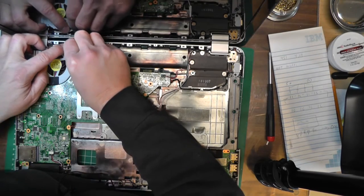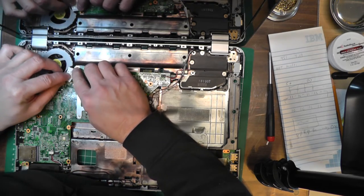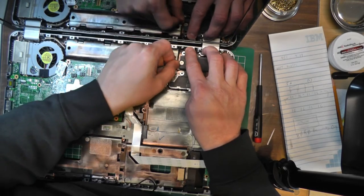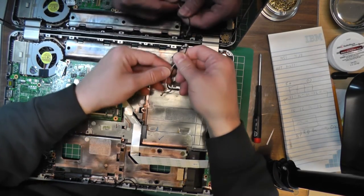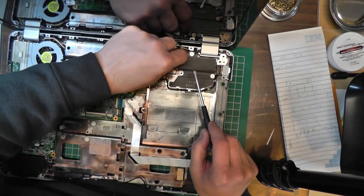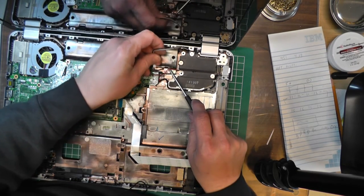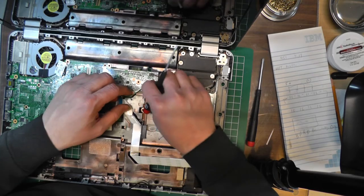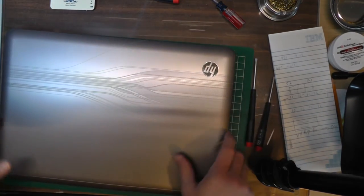You have to be careful with it when using it. The VGA cable plugs in here. I can see where it looks like it should go, but these should go underneath — this red wire I already put in here — and I need to get them in here. Actually, they need to go down through a hole underneath the motherboard into the bottom of the computer, for the Wi-Fi. I should be able to close this and flip it over. This one has a two on it, and there's a tiny little two marked there.